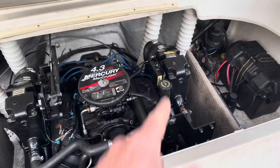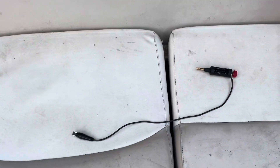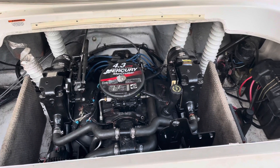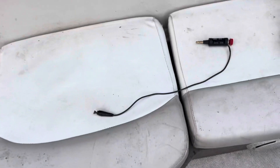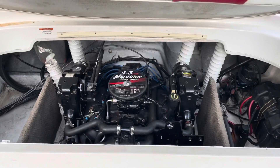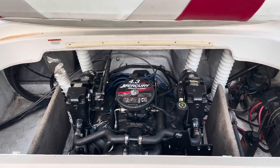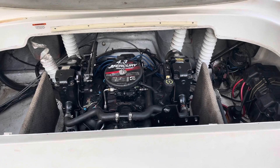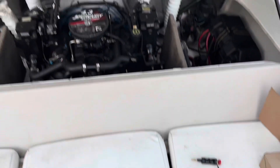I have not replaced it yet. I've got this spark tester device that I have not installed yet. The engine is running right now — it's just a tad rough, as you have seen. I'm going to show that when I put this spark tester device in, it won't even start, or barely starts and sputters. I believe the spark is very weak. After I put in the new Delco distributor, I believe the results of this device will show that it will be much stronger.